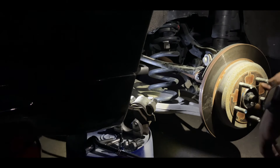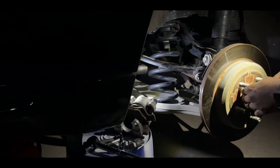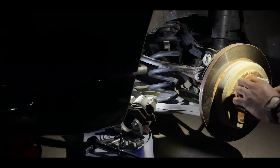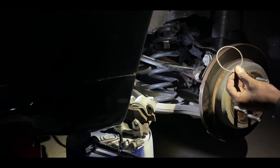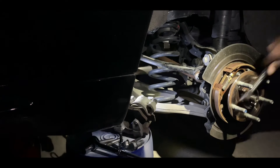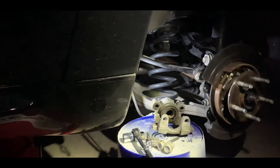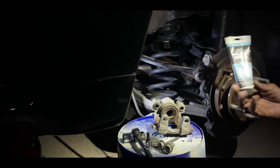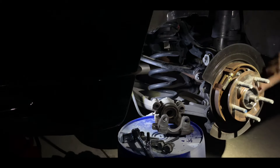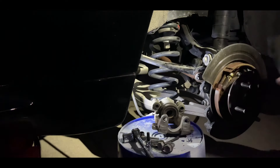In the rear there's also a ring in the back you'll want to remove in order to get the rotor off. Get something flat, get up in there, lift it and pull it right off. Then hit the area with brake cleaner. This is the rear rotor.